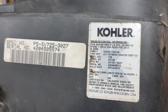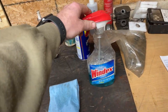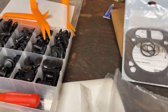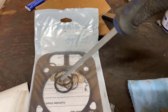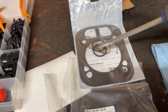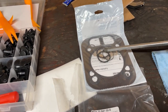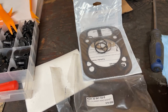Here's the make and model number just to show you guys what exact engine we're working on today. Here's what we're going to use to diagnose our head gasket. Here's the head gasket I ordered with the part number. We have a head gasket leak right on the side here. If it were to be failing right here — which they do, guys — the combustion chamber will be leaking into the crankcase right here where these push rods go in. You can just pull off your oil cap and see if you're getting any exhaust fumes coming out of the bottom end. A lot of times oil will present itself in all those areas too — that's how you know you have a head gasket.